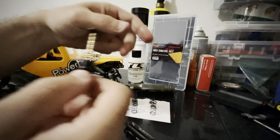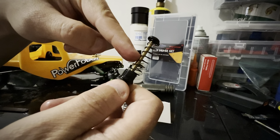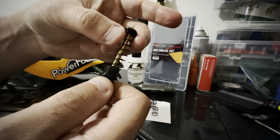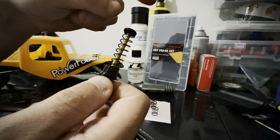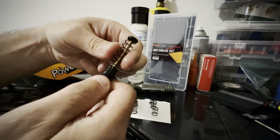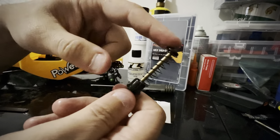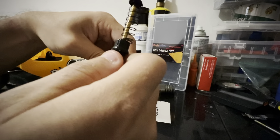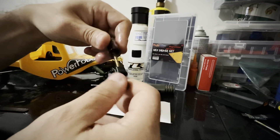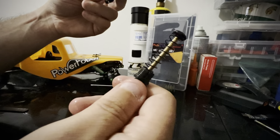The good thing is you can run different spring combinations. You can have a medium length spring below and a small spring up top, giving you like 70% droop and 25% sprung. You can do a whole bunch of different spring combinations if you want a little bit of a sprung setup. You could put one spring on top and another on the bottom — multiple different setups. One shock covers everything.